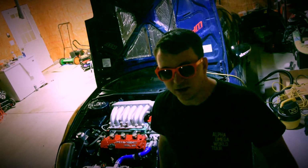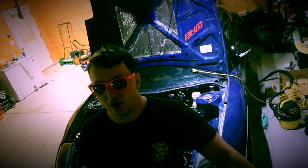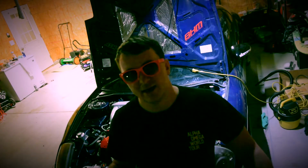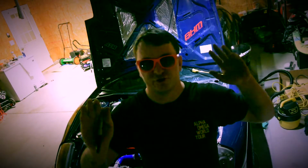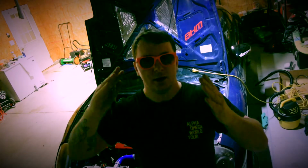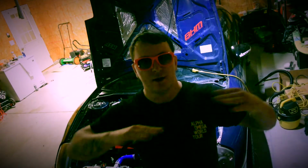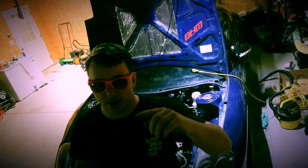Let's talk about the rear intermediate shaft. On the V6, if you haven't done a CV axle, on the passenger side it's not one single CV axle from the transmission to the tire. It's broken down. I kind of like it because it makes equal length shafts and you're not putting so much torque in the middle of that really long shaft.